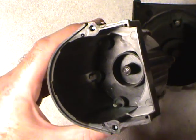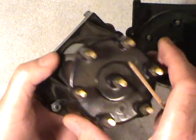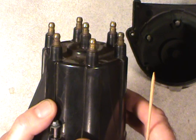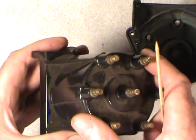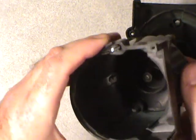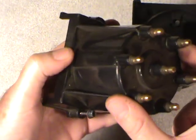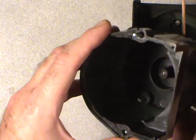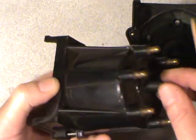This other one here — same thing inside — the carbon button is worn right down. It's something you don't see on the engine since it's usually sitting this way on top, near the rear somewhere, with the coil mounted separately. You have to check it with the engine cold and not running. If you have a van, you'll have to take the doghouse or engine cover off to get at it. A new cap is probably under $10 and a rotor might be a couple of bucks, or you can get them as a kit. It's your choice whether you want the aluminum pins or brass for a few extra bucks.